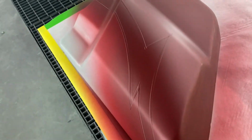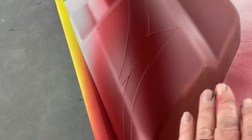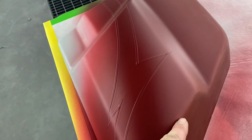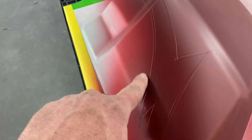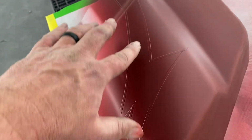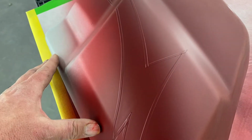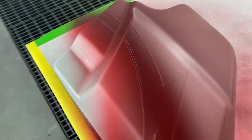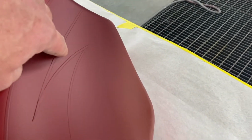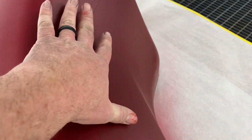Okay, now this base that I put on is dry, good and dry, so now I got to mask it up. Everything from here down is going to get painted black. And from this line up, it's going to get that charcoal metallic. So I've got the tape on this line and cover all of this up and paint this black on these side covers. And on the fairing here, I've got to mask everything from this line up so I can paint that black.